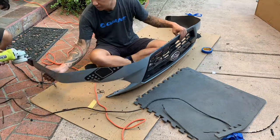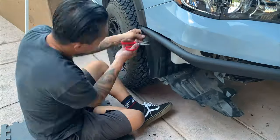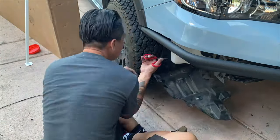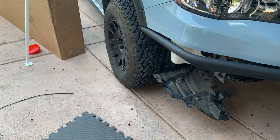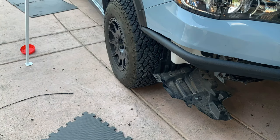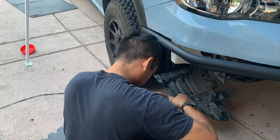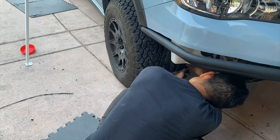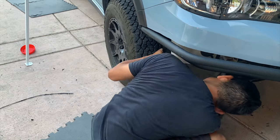The last step to tying everything together: remove your inner fender — they're going to hang super low — so you can use a box cutter. You could try to get the angle grinder in there, but you'd probably have to take the wheel off. Box cutter works pretty well. You might also need to relocate some small factory components; the washer fluid on the driver's side is hanging super low, and the other one is a runoff for the air intake — though apologize if that's not correct.